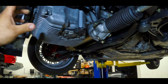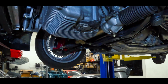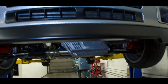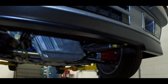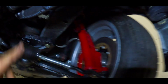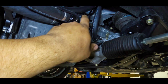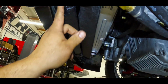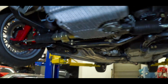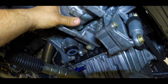This is the E34 oil pan, which is the front sump, which is what's typically used for all of the S52 swaps, very common. We are running a CSF upgraded oil cooler, so it's larger capacity. We made our own lines for the S54. These are S54 modified tubes, and then we modify the tubes going into the cooler. Has a CSF radiator which we modify. E36 AC compressor that we typically use because the AC lines work much better.